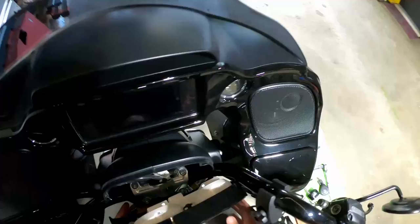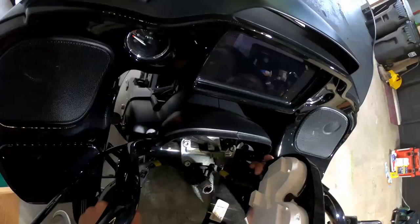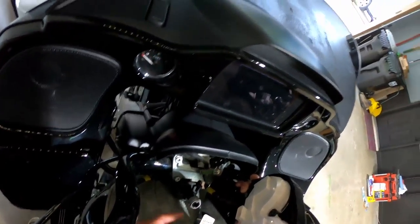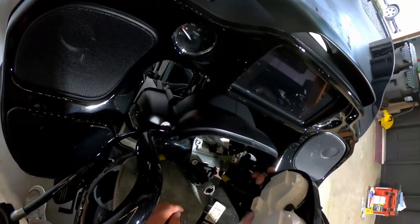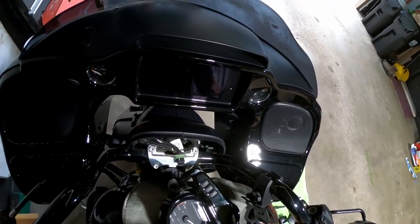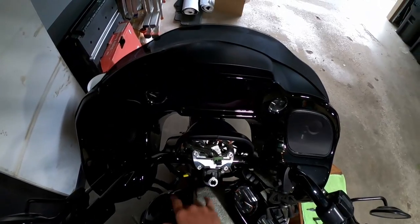You can try to get this other one off but I recommend you don't, and here's why — the tab on this one, which was facing upwards and easy to get to on the first one, is actually underneath on this one. The first time I did this I probably spent 20 minutes trying to get this piece off and it just wasn't fun. So we're going to shave 20 minutes off and leave it on there — just spin this piece like that, sink it down, make sure your towel is there so you're not scratching anything. Now you've got full access to the four bolts that hold in your handlebars.